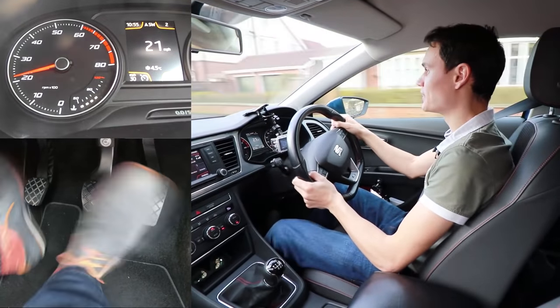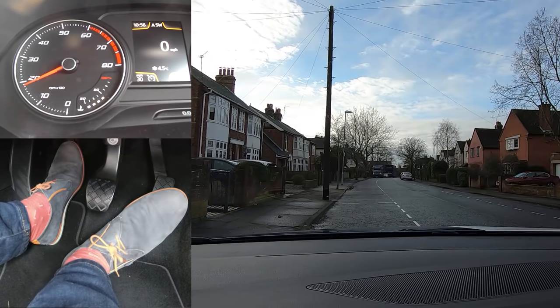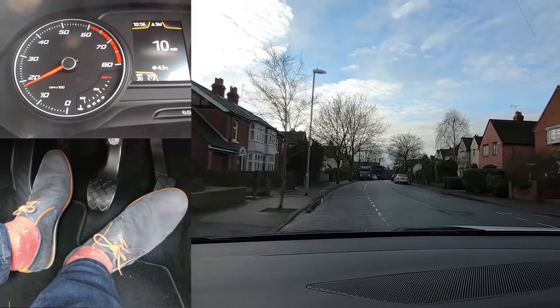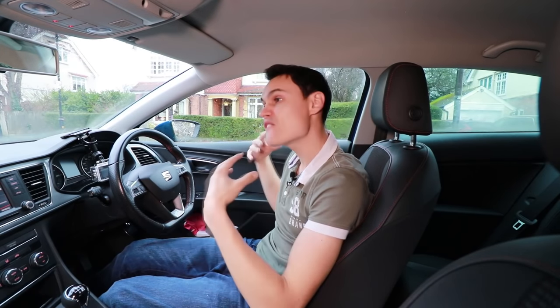I'll stop again and show you one more time. Into first gear, fully stop, gas - bite point - holding it - holding it - it's done. I can feel the vibrations have changed and the revs are going up as well, so I know it's finished. This is certainly a lesson that's easier to give in person than over a camera, because if you were here you could feel the steering wheel, feel the seat, and learn how it feels when there's clutch slippage and when there isn't. However, you can still feel it yourself in your own car - just pay attention to the vibrations and try to figure out the differences.